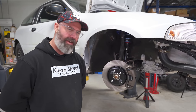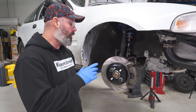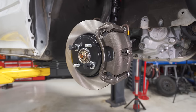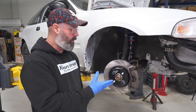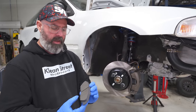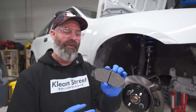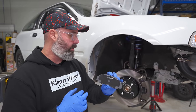Sorry, I had to tease you with the wheel and tire package there for a second, but not yet — you're going to have to wait for that. As you just saw, we did have to do a little bit of maintenance here. We changed out the wheel bearing because the one on the other side was bad, and figured preventatively let's change this one out too. We've gone with the so-called poor man's Type R big brake conversion — a 280 mm Mini Cooper S rotor, which has the right offset and bolt pattern to fit on a four-lug Honda. The rotor is from our friends at Pro Series, their OE Plus series, as well as the brake pads. The pads have some metallic material — possibly carbon ceramic — and a rubberized four-layer backing plate to ensure quietness. Really high quality stuff.